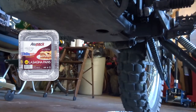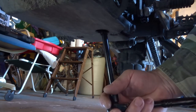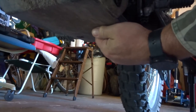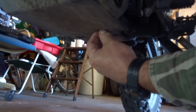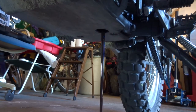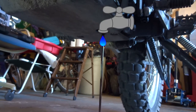Make sure you get your drain pan ready. The oil drain is located on the left-hand side — closest to the kickstand. This is the 12mm socket. Get it hooked on there. That's all it took — it broke loose, that was the snap. You should not end up making a big mess underneath the bike with the skid plate. The oil is coming straight out, straight down through the hole in the skid plate. Wait until you get a really slow drip or no drips at all, and then we'll move to the next step.